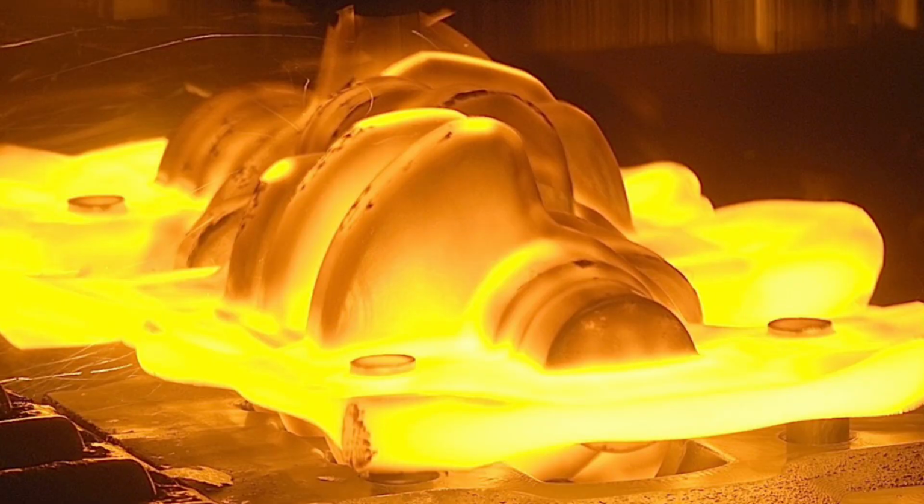The non-twisted forging is where the material is heated up and it is forged into position without twisting the crank. That's a little bit more expensive. However, the twisted crank, being the most common, really is going to be strong enough for most applications. Now, a forged crank can be made out of a variety of steel alloys, from 1053, 1045 mild carbon steel to all different kinds of alloys, which we're going to talk about in a second. But it's that wide variety of alloys that can be used to make a forged crank that allows you to choose a wider range of applications.